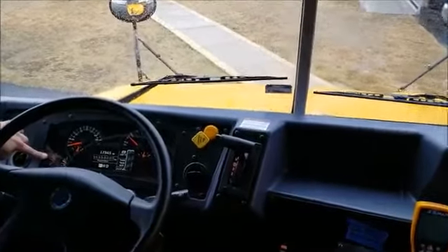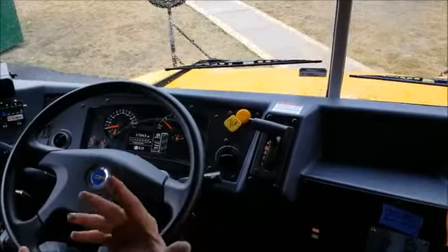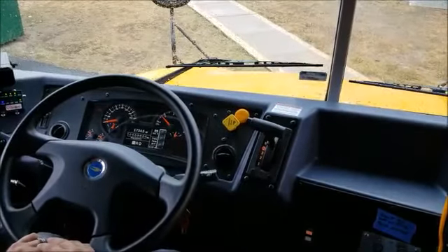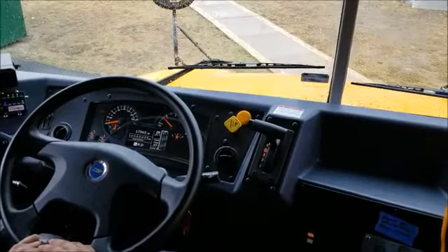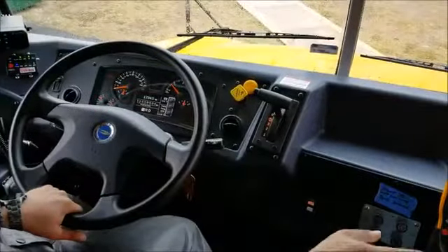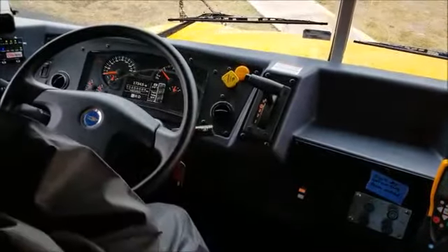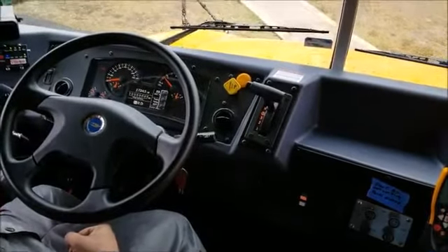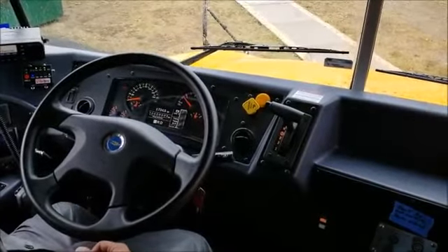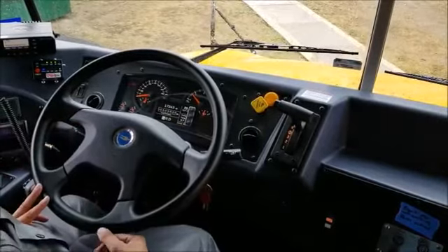At this point you'll probably still have a little bit more time to wait and it's going to feel like an eternity, so just glance around the bus and make sure you remember to mention everything — the emergency exits, all that stuff. Just give yourself a chance to double-check your work. They're not going to require you to open things up and verify; you just have to say what you're checking for. We make sure everything is there before the test — that mirrors are clean and clear, there are no illegal stickers, registration, inspection, and insurance are all up to date.